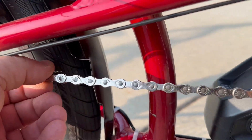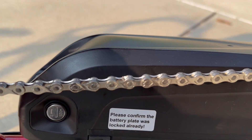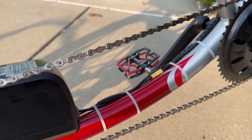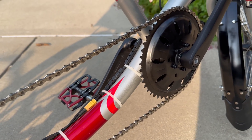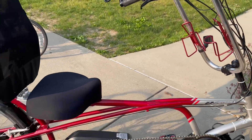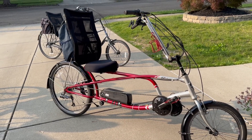The second mod is that I had to cut the fender to clear the chain. I also replaced the chain — this is a KMC e-rated chain, specifically a KMC e9 for a 9-speed drivetrain, designed to handle the extra power and abuse of an e-assist drivetrain. Right now it's set so that riding around town on level one does just a little more than overcome the weight of the kit, and you feel like you're pedaling, but it's only using five percent of the drivetrain's available power.